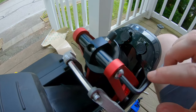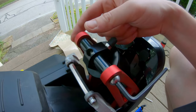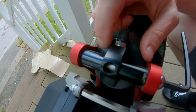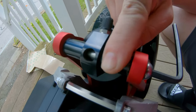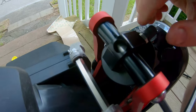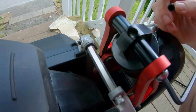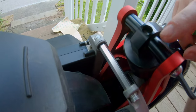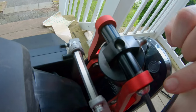This side was incredibly tight. This side wasn't as bad. But look at this bushing — no movement at all, this one is tight as anything. I can rotate it if I get in there, but it's really not wanting to go anywhere. So we're going to depressurize the system again. That loosened up a lot of pressure. Let's see if greasing this all up is our issue right there.